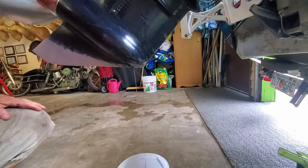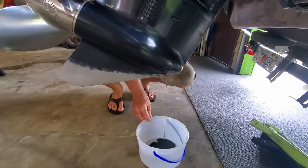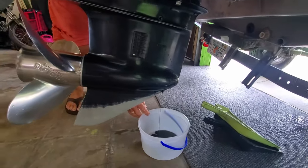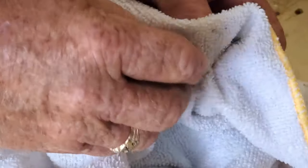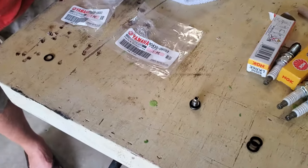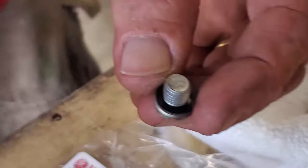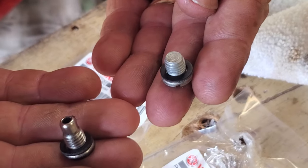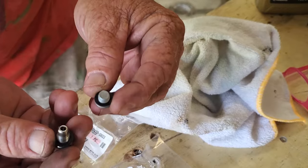Keep your screws separated — top from bottom. Now lower it down and just let it drain. The lower unit oil is about drained. Take your plugs, take your old seal off, wipe it and clean it, put a new seal on — that's your bottom plug. Take your top plug, remove the old seal, wipe it and clean it, put the new one on. The bottom one has the magnet to collect any shavings. They're different sizes so you can't mix them up.